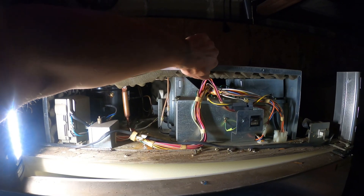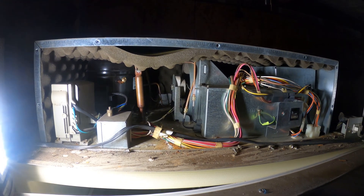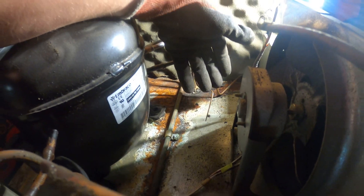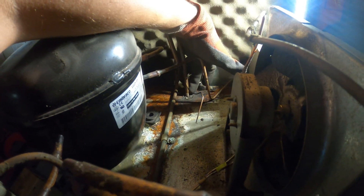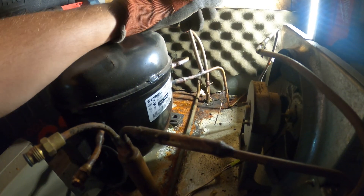Let's start taking this off and see what's going on. I have a capillary tube in my truck. We got the screws off and now we can work in peace. There's quite a trail of rust here, and if we look closely, this pipe is just hanging. This is the capillary tube and it goes down this hole right here, so we're going to have to get access inside and replace it.